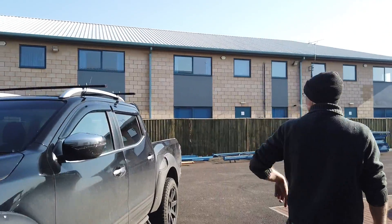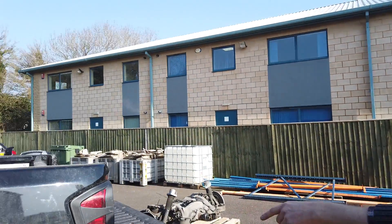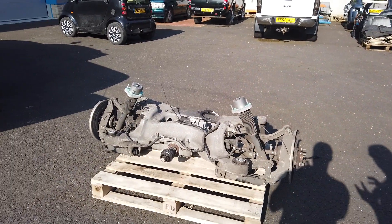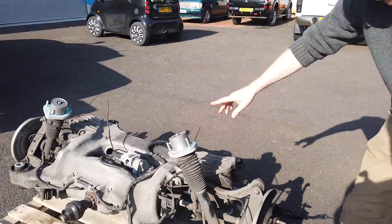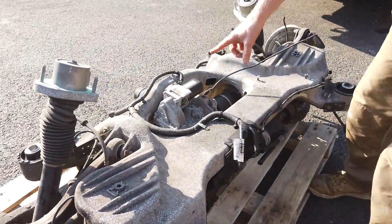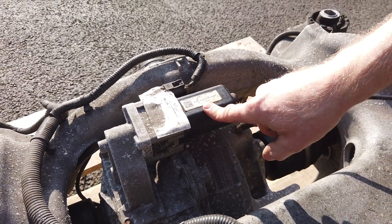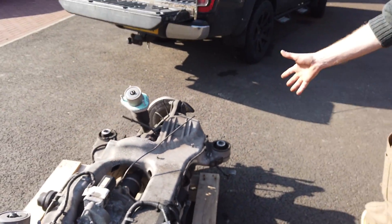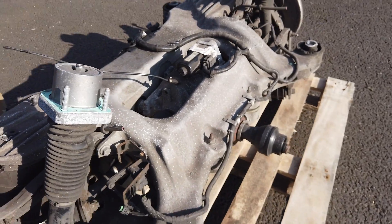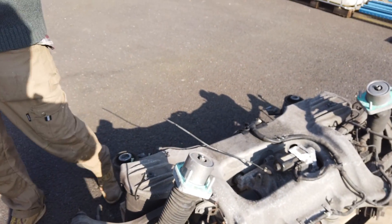We fixed the fence - not perfect but we'll get a new one fitted. Now this down here is getting no love but it gets used all the time - this is a Range Rover Sport complete rear subframe with shock absorbers and gas struts. The brakes are missing but I needed it for an e-diff error - this is the electronic actuator that locks your diff, and mine is playing up. It was cheaper to buy the whole subframe locally on eBay for £250. I've also stolen the wiring connectors off it for our electronic brake actuator conversion.